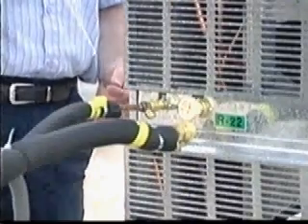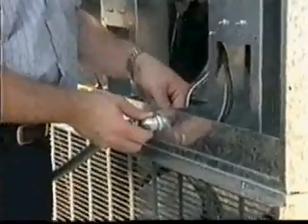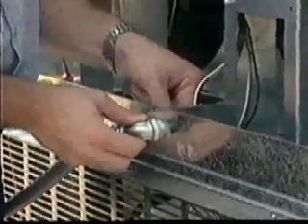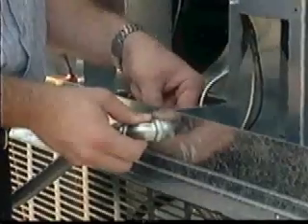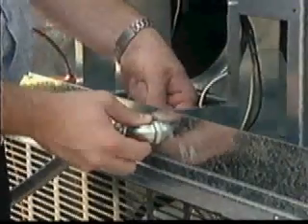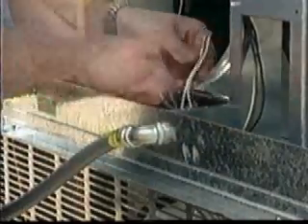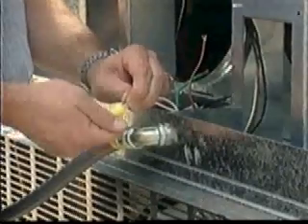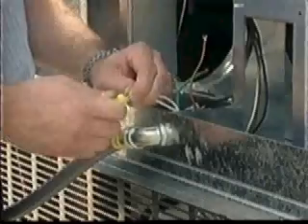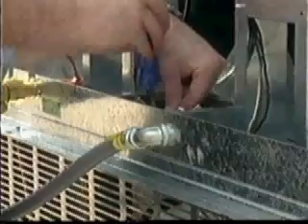This provides a leak-free brass-to-brass seal. The fan control wiring from the ice-making unit requires a three-wire circuit. To connect this circuit, first remove the louver panel and junction box cover from the condenser unit. This circuit should be routed through seal-tight conduit; a disconnect may be required by local code. Connect the fan motor leads in the junction box of the remote condenser unit to the fan motor leads in the junction box of the ice maker. A proper ground wire is required to prevent possible electrical shock.